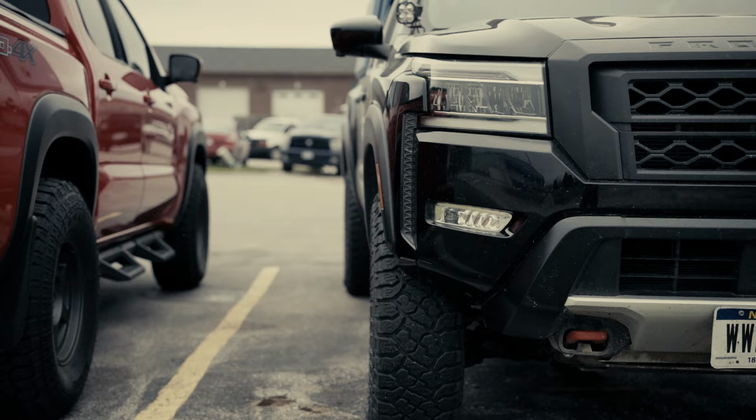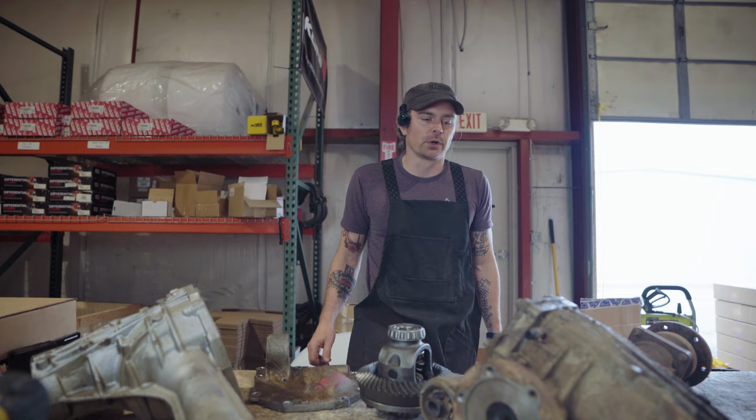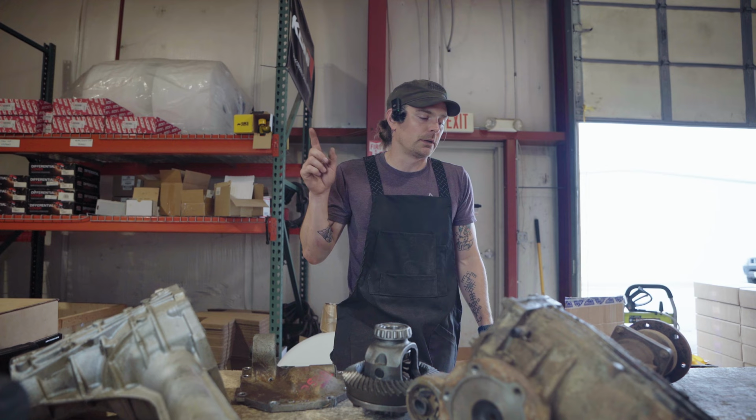What's up, guys? This is Chad at Alldogs Offroad, and today we're going to be doing an M205 regear video for you. We're going to strip this guy down and do a little bit of R&D work. I've got some prototype 4.08 ratio gears that are going to go in there, and then those will eventually go into my truck along with the matching gear set for the rear M226.